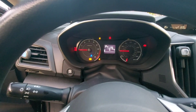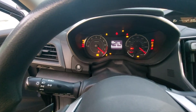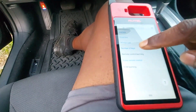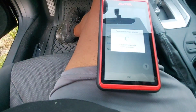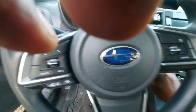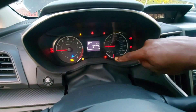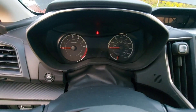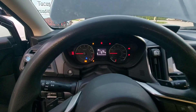The immobilizer light has gone out. This car has a bad head gasket so I can't actually try to start it, but it looks like this key actually programmed. I'll go back and read the number of keys — it's still only telling me one key is in the system. If I put the unchipped key in, the immobilizer light comes on. I put the new key in and turn it on — the immobilizer light does not come on. I'm going to chalk this up as a success.